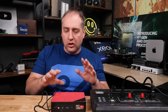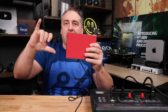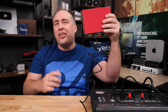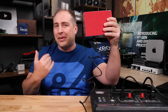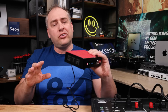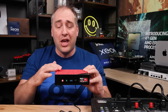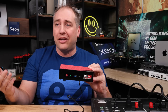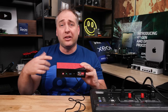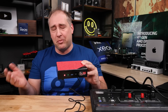The thing I want to talk about is the noise. Even at idle — around 10 watts — this thing is definitely not quiet. I wish this was a little bit quieter, especially at idle. Just imagine you had this as a home theater PC sitting next to your TV, maybe not even using it, and you can hear this little fan going. I do want to point out that we have it in 45W mode, which is the default. You can put it in 35W mode, which lowers power consumption quite a bit, but then you get less performance — and then why are you buying a higher-performing chip?